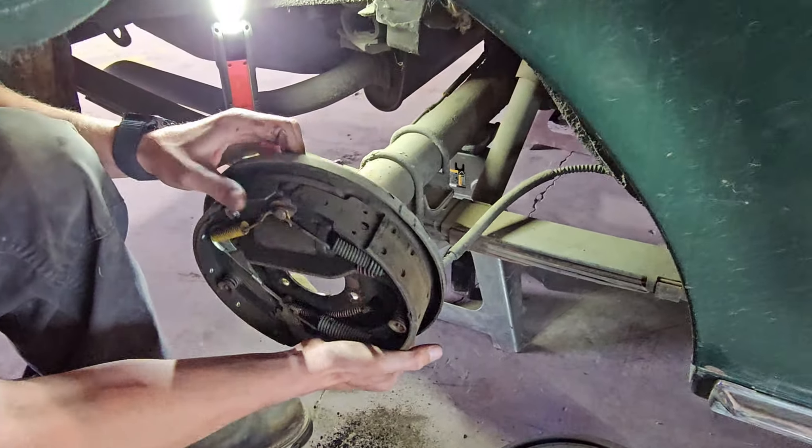This Mustang's got some major stopping power now. We tackled a four-wheel disc brake conversion on this classic 67 Mustang, outfitted with a kit from the Right Stuff brand — and it gave this pony some extra stopping power. We had our challenges with this project: we ran into a few cracked parts, there was mislabeling on the caliper brackets, incorrect rotors shipped initially, a proportioning valve fitting size mismatch, and quite a bit of modification required to make this kit work. Because of these unexpected issues, we wouldn't recommend it to your average DIY mechanic — it took quite a bit of know-how and problem solving. But in the end, this was a great upgrade for our customer and they got a lot of bang for their buck. Don't forget to like and subscribe so you never miss an episode.